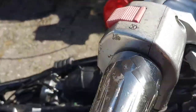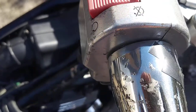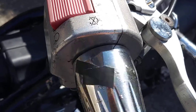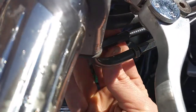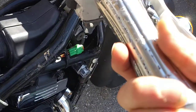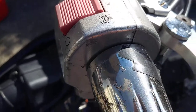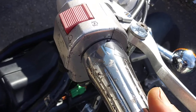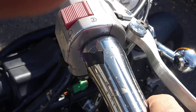Test it again — you'll see how it's tightened up. Keep doing that until you still have some play, then slack it off a little to make sure it's free and clear of any interruption. You only want about a millimeter to a millimeter and a half of movement here. The most important thing is that your throttle response is smooth and forceful on the open, and when you let go it snaps back hard.